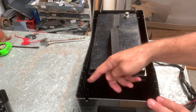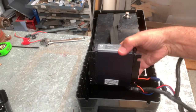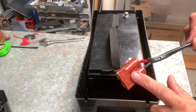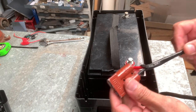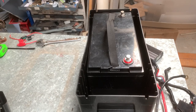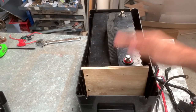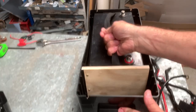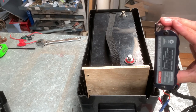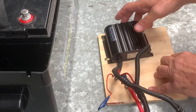I put the battery inside the box. There's a cavity in the bigger battery box, so I'm going to put my DC charger inside it too — you'll only see the cable which I'll need to run to the start battery. To make this portable, all you do is disconnect this and carry the battery box away. I'm making a piece of plywood as my divider to stop the battery sliding, and also to mount my DC charger to.